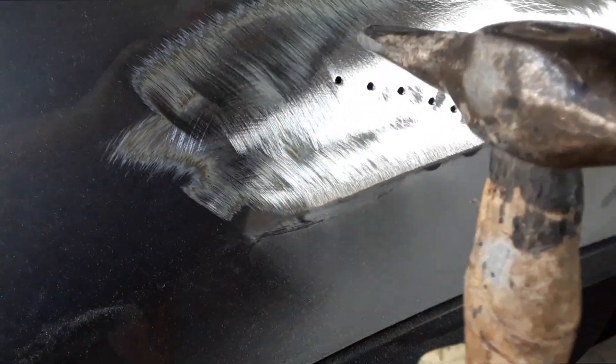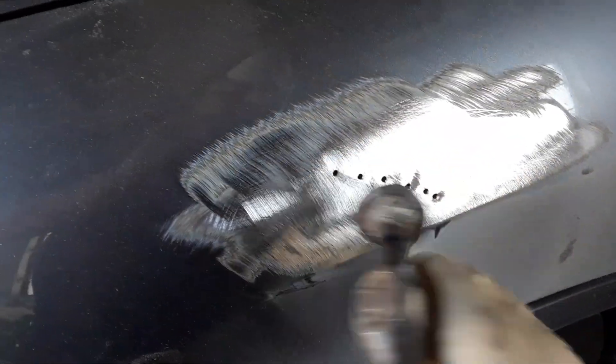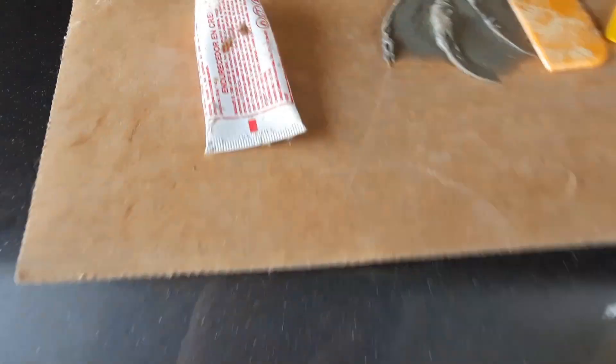It's important that these little holes here are slightly below grade, because what we're going to do is bridge over top of everything — create like a bridge. You won't notice. So what I'm going to use here is some fiberglass. I always like using fiberglass for a first coat, and then we're going to go to a regular Bondo. My preference is fiberglass.